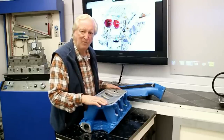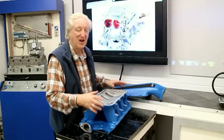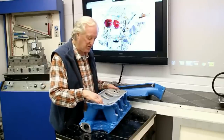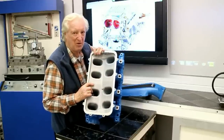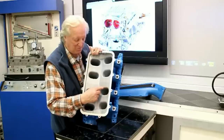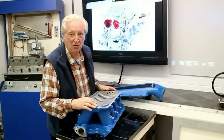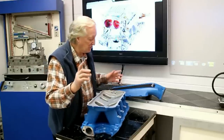This manifold will be right at home on a 900 horsepower Small Block Chevy, but you're going to have to build a pretty stout motor to use the full potential of this as-is. So here's what I'm seeing — this manifold is going to be an absolutely terrific street manifold so long as the engine builder sizes the runners here appropriately. This size here is a big horsepower runner size. I'm building something around 700 horsepower, so I'm going to have to make this opening probably 20% smaller — same shape, blend it all down — and what that's going to do is give me street torque while still making 700 horsepower and the street drivability of a very civilized motor. So that's what Holley's offering at the moment.